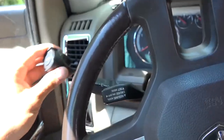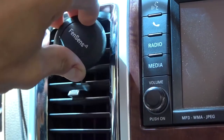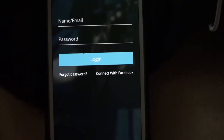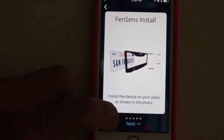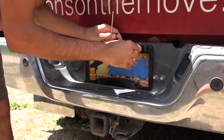After you get the license plate installed, you install the quick launch button inside your vehicle and set up your cell phone holder if you want. Then you download the app from Google Play or the App Store and set up an account with FenSense to connect your sensor. Once your account is set up, make sure your Bluetooth is on and the app will find and connect to the sensor. It then walks you through setup parameters — how high it is from the ground, and whether it's upside down or right side up, which you might need if installed on the back of a truck where the bumper could interfere.